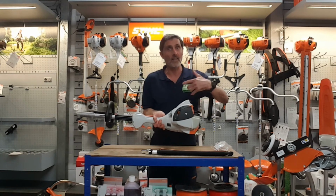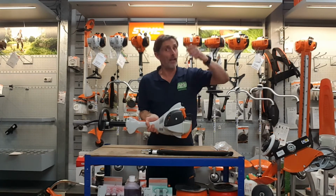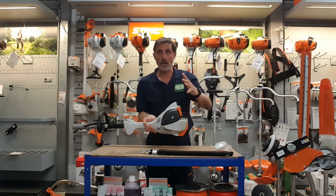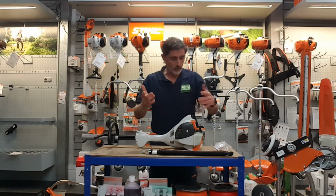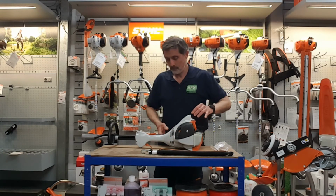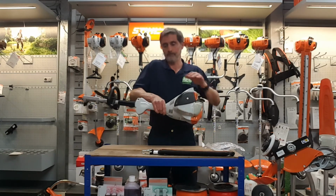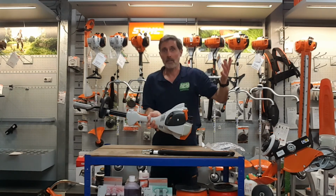There you go. So on this occasion, that wasn't loud enough for you, those are my pulls with my left arm, and I'm not in the best position from being on the ground. So I'm really struggling, and it fired up lovely. But there you go, just showed you, cool, and it's pittered out. I'm not going to rush, because I don't need to. I'll put this on half choke. I'll give it a few more squirts, and then I'll give a few more pulls. I can't say no more than that.